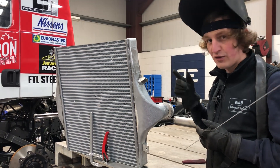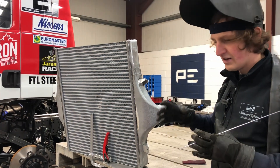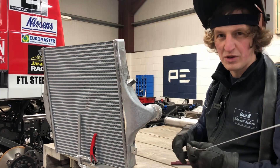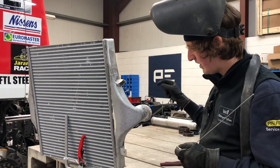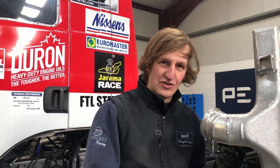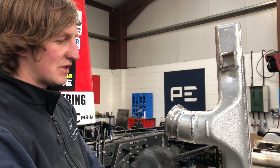The engine we're running 3.5 bar of boost, so we need more than the standard silicon hose with a hose clamp — they're not good enough so we have to run special ones, and that's how we found this one. The intercooler is a standard sort of intercooler; we just change these boost clamps and the brackets.